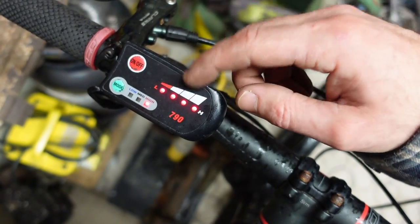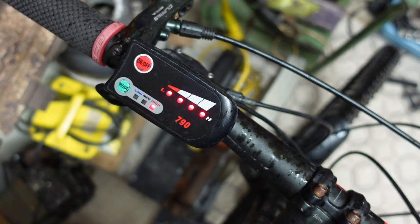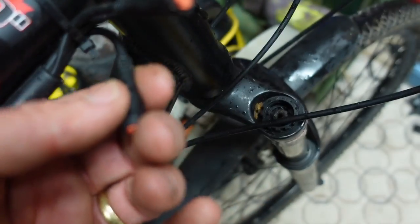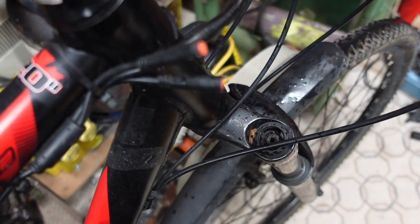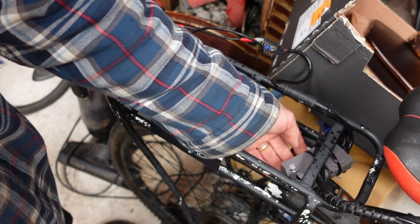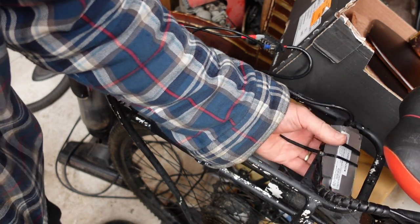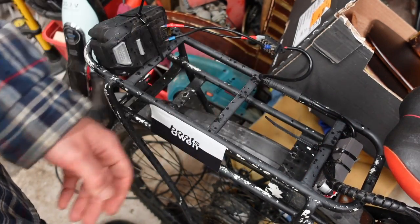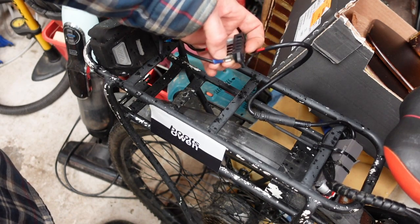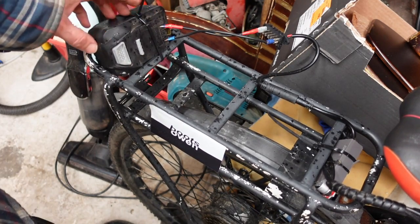It says it's a 790 and that's the battery charge state indicator. Maybe I should look up what that is. It's just mounted on there with a little screw mount fixing — pretty simple really. And here are the two cables that have nothing attached to them. I think there's just a wire on each side and if you put a micro switch across them or just jump them, it stops the motor turning. Towards the rear here, this was all encased in a plastic box but it's all just hanging loose now. You've got this grey box, I've just held it on with a cable tie — that's the controller. It's a WZKD3615KA and they're quite expensive online. That's the connector that would have attached to the battery but I've just put a cable across — a standard spade connector fits on there, I think they're 6mm, positive and negative.